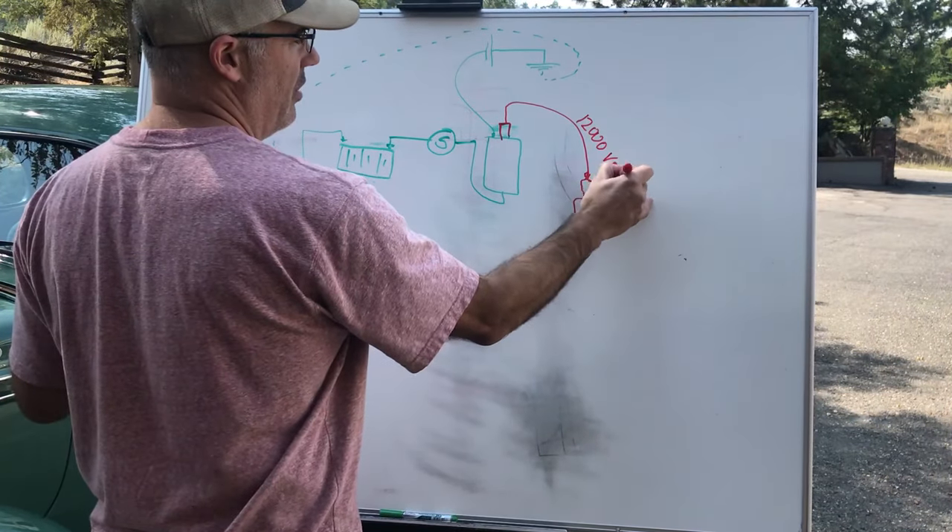Here's a really bad example of a wire that comes from the coil and goes into the distributor. There's the condenser, there are the points opening and closing, and look at this — it's brutal. This piece of metal here cannot be touching the distributor housing, because the spark needs to go through it and right to the points. If it arcs to ground here, the points are doing nothing — the 6-volt primary is taking a shortcut to ground and you have no spark.